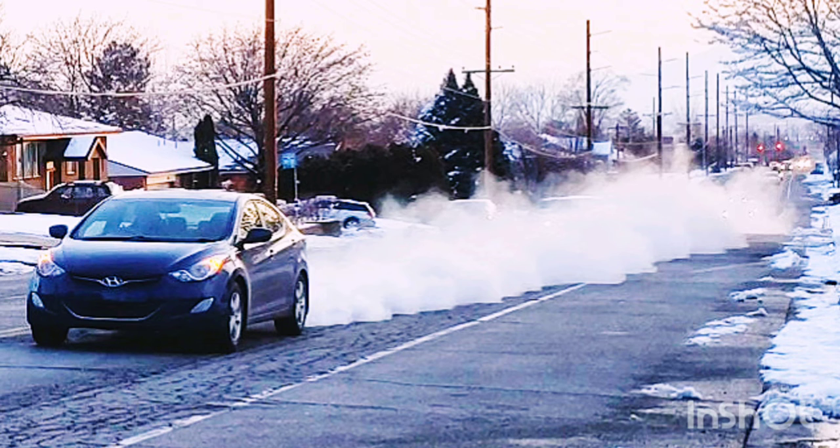Before you do this, you're going to want to make sure that your car is warmed up, because that's what the instructions say for the cleaner that you spray into the throttle body. I did the top engine clean on a 2013 Hyundai Elantra, but if you are doing it on a different vehicle, the concepts are pretty much the same. The only thing that might be different is that on other vehicles you want to unplug the mass airflow sensor before you start working on it.